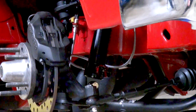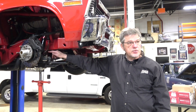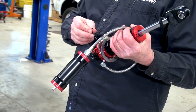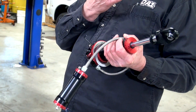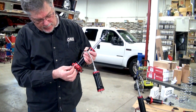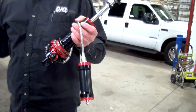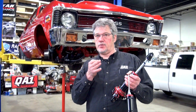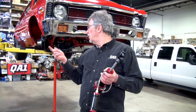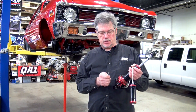Another really cool feature of this shock is the low-speed bleed. When you jack up the compression on a shock like this, what happens is the front end sits kind of high going down the track because the shock doesn't bleed off at all. So I'm going to open up this hole and loosen up the bleed on the compression. What's going to happen is — with a lot of compression valving in the shock so it doesn't bottom out — I also want the shock to bleed off and let the front end settle down so I'm not pushing air going down the track. It'll improve miles per hour and ET with bleed in the shock. That's another feature that makes this stand apart from other shocks on the market.